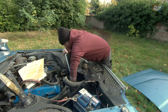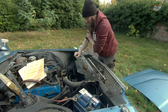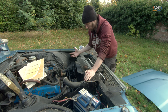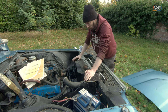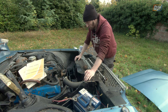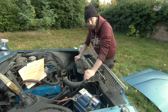Just over two full turns - I hear a little bit of compression leaking out somewhere over here, which is pretty much what I'd expect. Everything felt nice and smooth, it was stiff which you'd expect given how long it's been sat, but it didn't feel crunchy - just a sort of heavy continuous resistance, which I think is about right. From my position I feel pretty happy we can turn this over, and even if something is wrong it's not going to be catastrophically mechanically wrong.